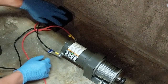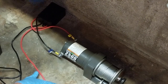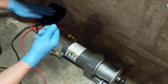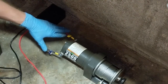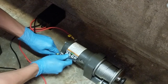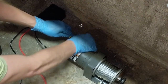There are some obvious notes here: make sure that you don't install the cabling in the way of the winch, and make sure the control box is in a safe place. It probably also receives the signal from the wireless remote, so you probably want it in a raised position. For right now I'm just going to leave it right here, and obviously tighten these connections down nice and firmly — they appear to be basically a 10 millimeter. No need to over-tighten them; you don't want to break any terminals.